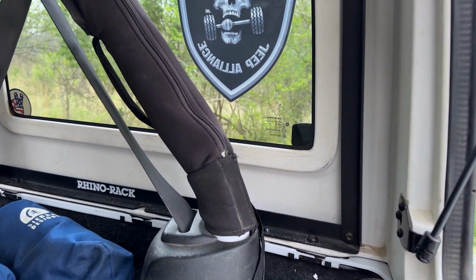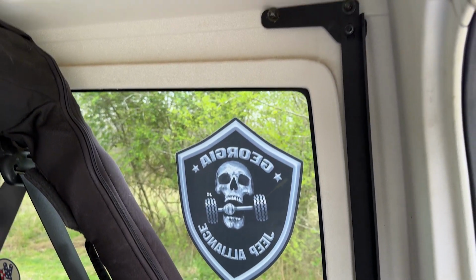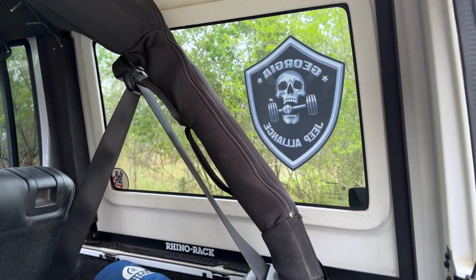Now, I also love that the skeleton on the inside that is built into the frame of this hardtop is going to still enable us to remove the hardtop as easy as possible when it comes to the summertime. Now, some highlights that I want to note is you are working with fiberglass. So what I noticed last night is my hands were itching like crazy after drilling and wiping things away. So you might want to wear maybe some rubber gloves or something. Also, this front piece here, whenever the directions say drill at a 90 degrees, that means 90 degrees straight down, not 90 degrees to the curvature of the hardtop.